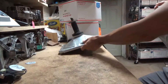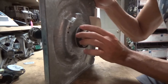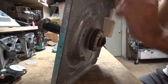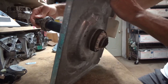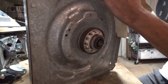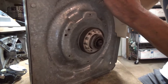Now here's one that's not good. The outer part is actually spinning smoothly, so you might think it's okay. But watch when I test the inner shaft — listen to that grinding. That's bad. That's what you do not want to hear. So this is a bad gear case. You might normally miss that, but it's something you definitely need to check.